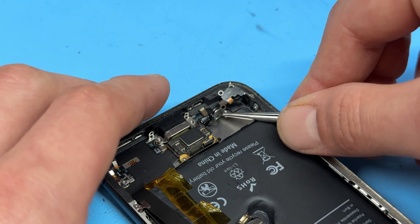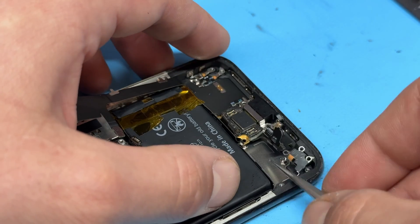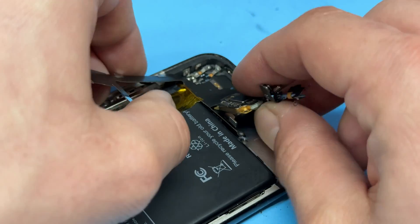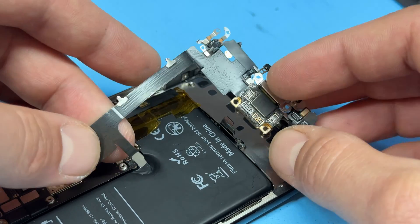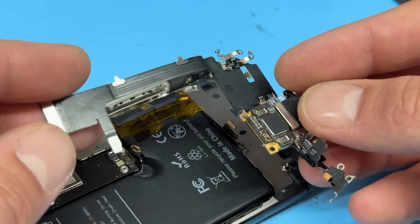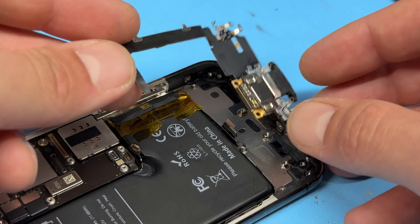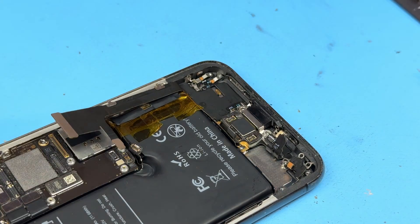The barometer sensor and microphone now unfold to release the plastic jig that holds them in place. We should now be able to remove the charging port flex cable, starting off in this bottom corner and carefully lifting it up — these are actually refurbishable, so I'm trying my best not to damage any of it whilst removing it. That lifts out quite easily although it is stuck down a little bit so you might need to give it a little tug. The part we're using is a genuine pulled Apple part — I've literally just pulled it from another iPhone 11 Pro.